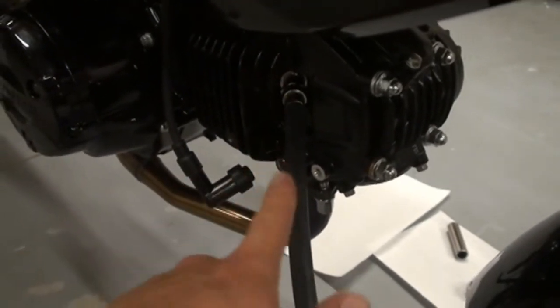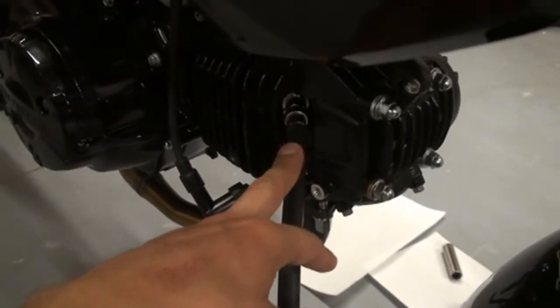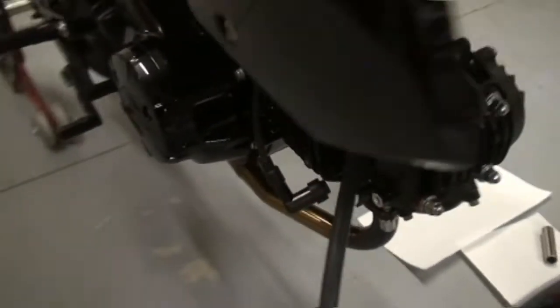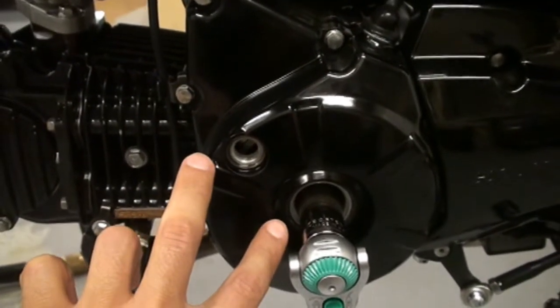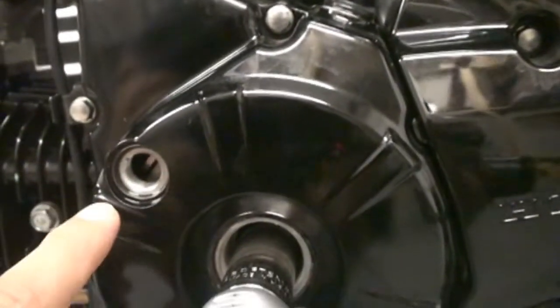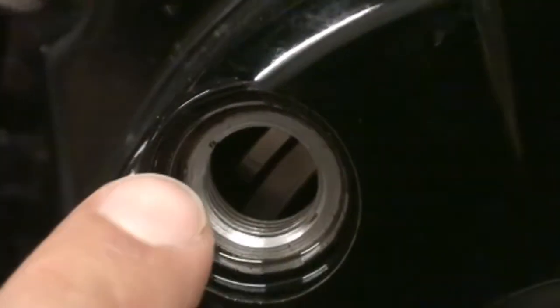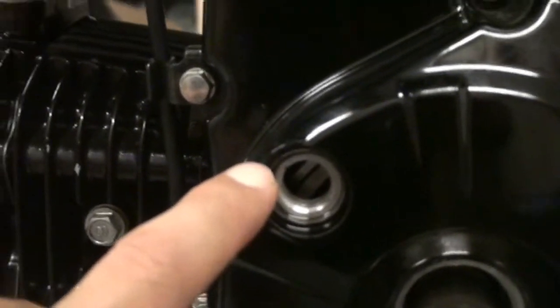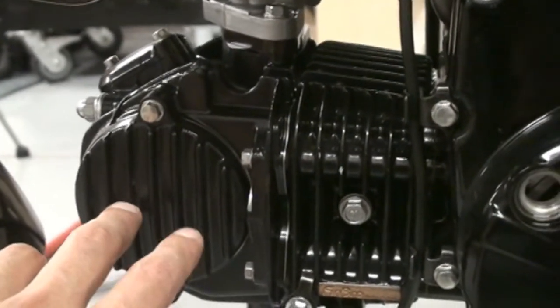What you need to do to prepare is: A, warm up your motor to operating temperature - over 200 degrees - so everything's nice and hot inside. Then pop out your inspection caps and set your motor at TDC, where the T mark lines up. This is very important - it must be at top dead center so that both valves are closed. It's the only way to get an accurate reading.